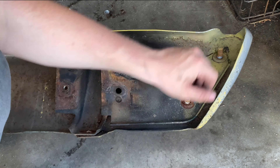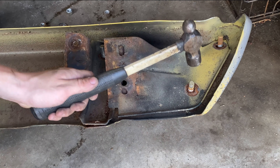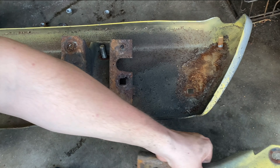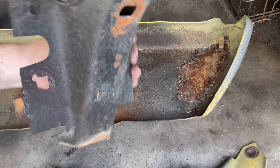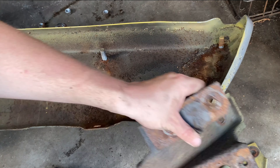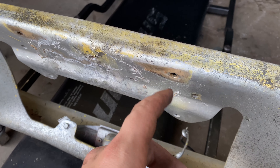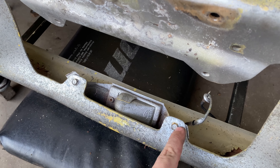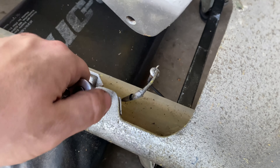Now we can pull these brackets off. Pull this one off to get my air shock line out and pull this one loose — these are individual brackets. This is just a support bracket basically, and this is actually what bolts the bumper to the car. These bolts are three-quarter — all four, two here, two here, four on each side. The new bumper comes with new bolts to mount this, but we've got to reuse these. I'm gonna take these off, clean them up, paint them, and put them on the new bumper. I believe they give you new washers as well.